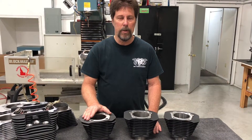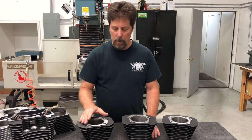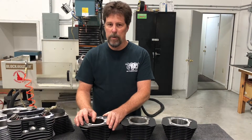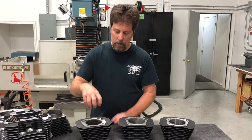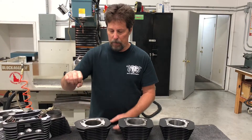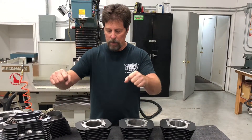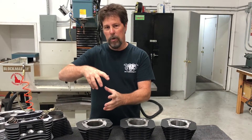Going any bigger than that puts you at risk of cracking, but really there's more to it than just the possibility of cracking the cylinder. Anytime you make that liner thinner, you make it weaker. A running motor is subject to a lot of distortion in the cylinder. You've got a fire burning up top, the heat is not uniformly distributed, you've got a bracket tying it to the frame, and another steel bracket connecting the two cylinders together. So the cylinder is growing, but not evenly, and things attached to it aren't growing by the same amount — it's twisting and distorting as it warms up.